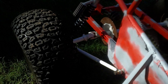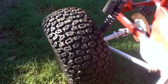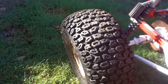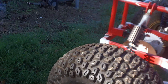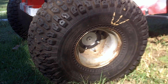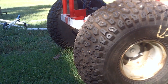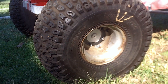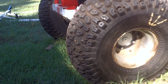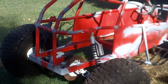The suspension rebuilt quite well, but the only mods I have to finish are probably welding the yoke tubes to the axles to make sure they stay solid — I don't think they'll withstand the horsepower as-is. The back tires and rims are off a Suzuki; I do have adapters, but I'll probably end up ordering blank rims from Rocky Mountain or Dennis Kirk. You can order a blank rim with the inside diameter cut the way you want, then drill your own bolt pattern. I was looking at keeping a 25-inch diameter tire both front and rear — I've got a good amount of ground clearance.